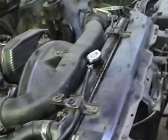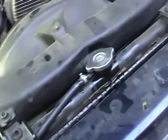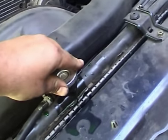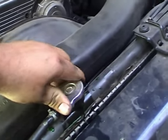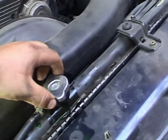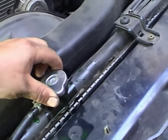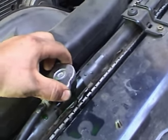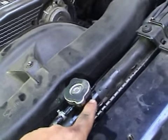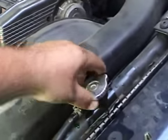If the pipe isn't hot, if it's cool, then it means that the water isn't too hot, and you should very, very slowly open it, and you'll feel it loosen. Now if it's pushing, even when it should not be, you see here it's a bit wobbly. If it doesn't get wobbly at that stage, do not progress. You'll see if it is hot, there'll be steam, there'll be coolant pouring out the side. Try and tighten it back up.